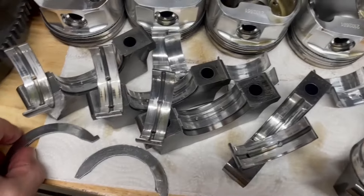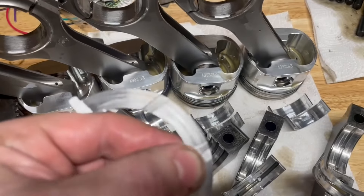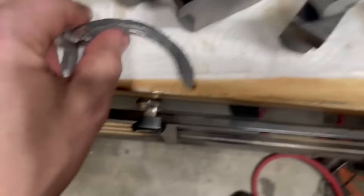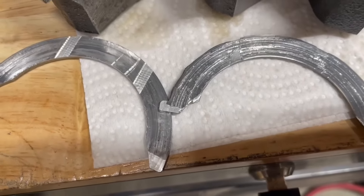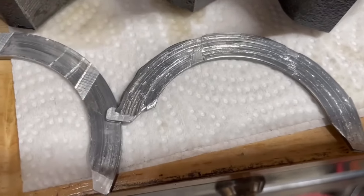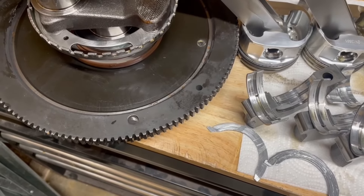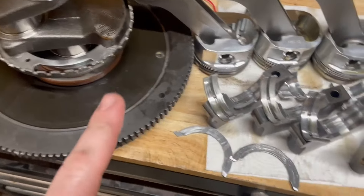With one exception. This is your thrust washer — this is what it's supposed to look like when used. But this is the clutch and flywheel side and it's flattened — it's smushed, severely damaged. Which means the crank has been thrusting forward, away from the flywheel. We have a thrust problem. That could come down to our clutch slave cylinder needing to be shimmed back, or we need to find a way to reduce the pedal throw, or we could have crank shift which could be related to the issue we have with the nose.